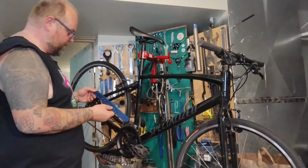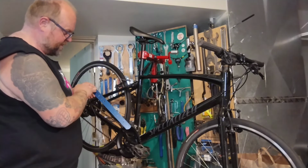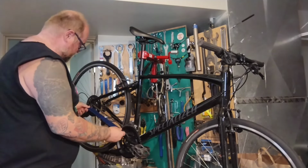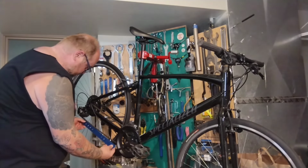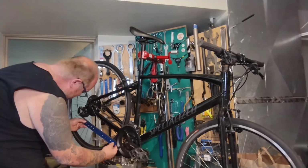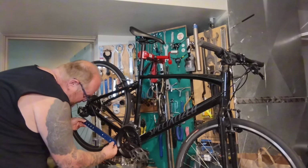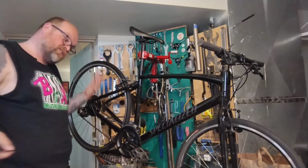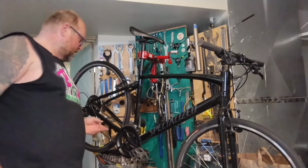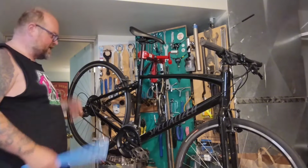So grab a good high-quality ruler and line up the arrow right at the very beginning of your ruler, your standard inch ruler side, and line up the arrow right at 12 inches. And come down to this chain and line it right up. So that first arrow right in this first pin, and the last arrow, and they should both be dead center in these chain pins. And this one is definitely not, it's over like a millimeter. This chain's stretched.